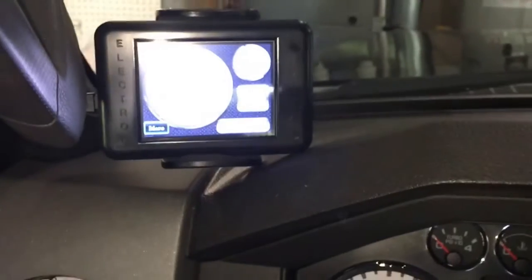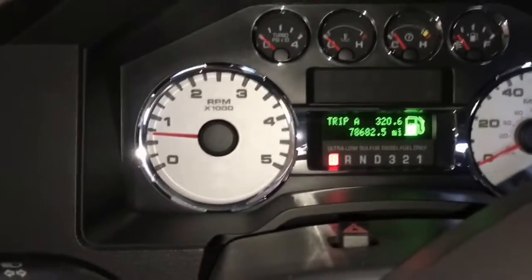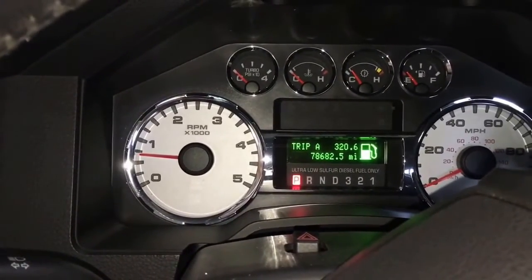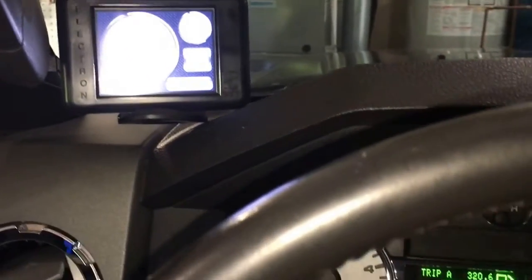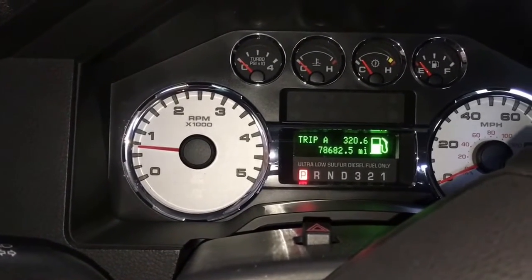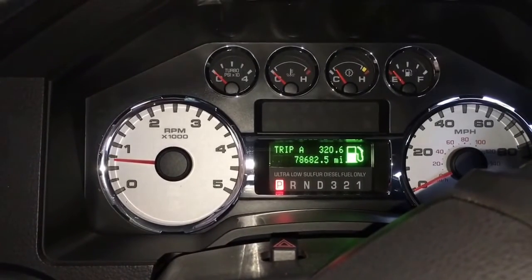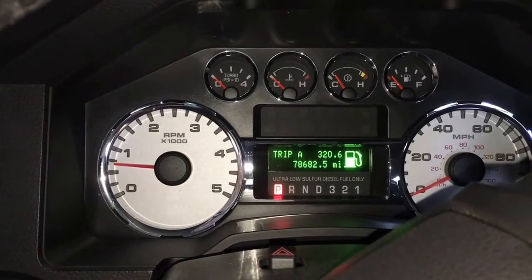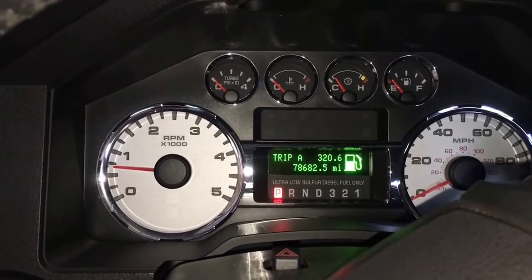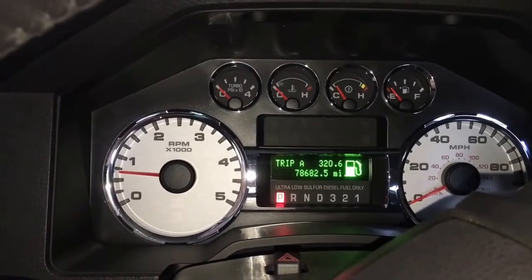Problem solved. Got a nice powerful 200 amp alternator in there now. No more battery lights showing up on the dash. As one last precaution, I'm going to run out to Costco and buy two brand new batteries, so everything will be nice and fresh. Hope you liked it and hope you learned something — hopefully this helps somebody tackle the next job. I didn't have to rip anything out of the top of the engine like some other mechanics on YouTube will show you. Just get everything through that wheel well. The hardest part is getting a ratchet on that tensioner. Thanks for watching.